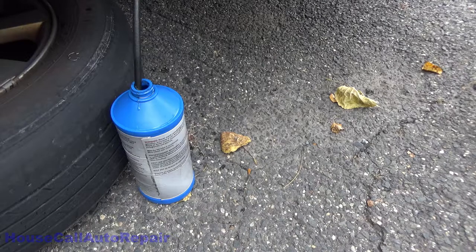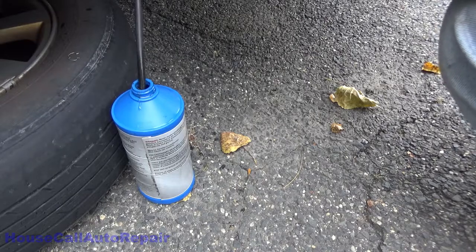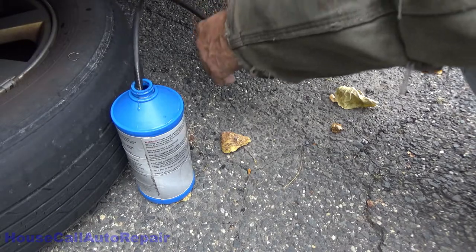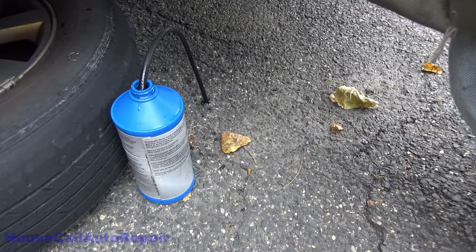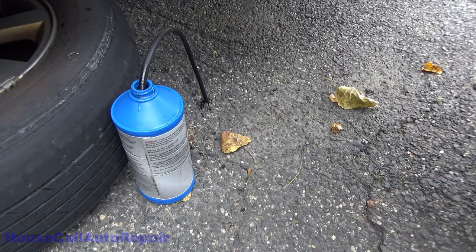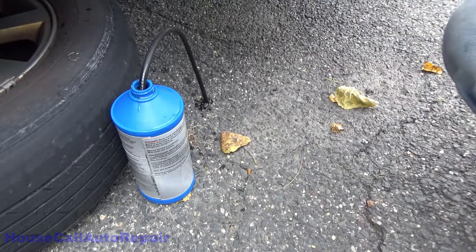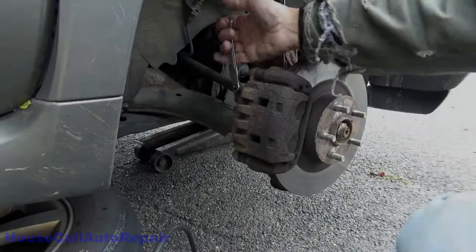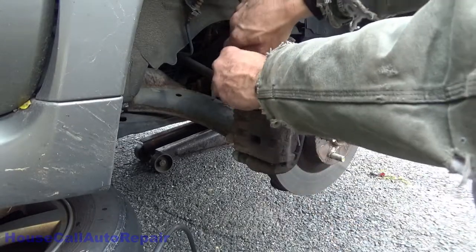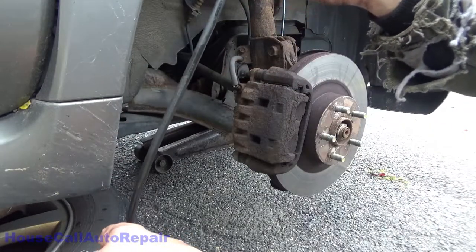I am now super satisfied with the way this brake pedal feels. So, let's see what we got coming out. We got clear fluid or not. Oh yeah, that's coming out of there nice and clear now. And I just got the brake fluid from that bag all over my hands. Double check the way that brake pedal feels again. Hose out of here.